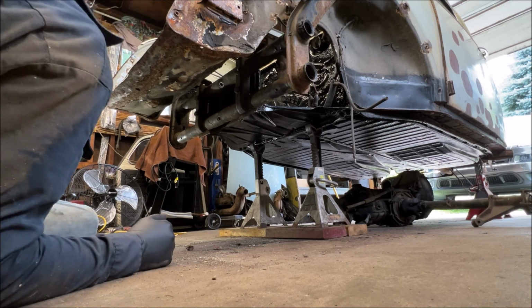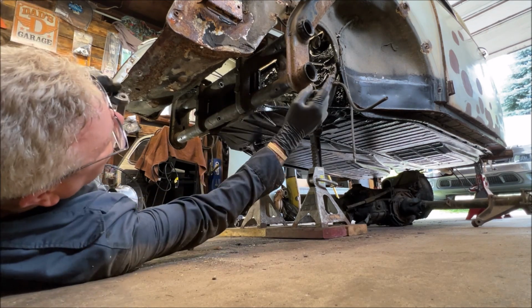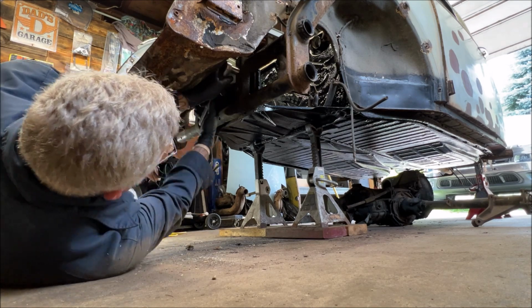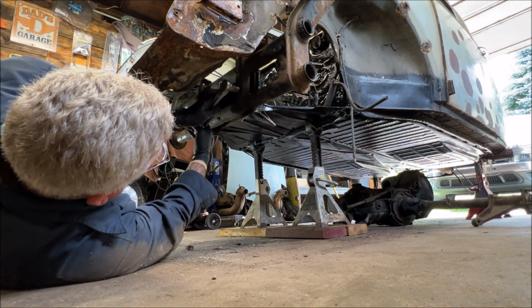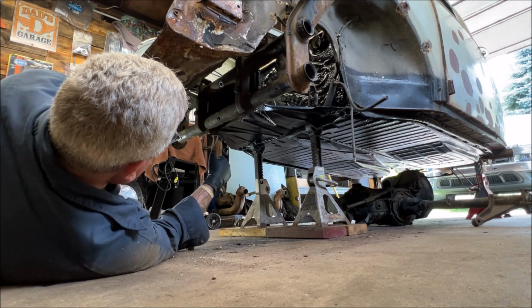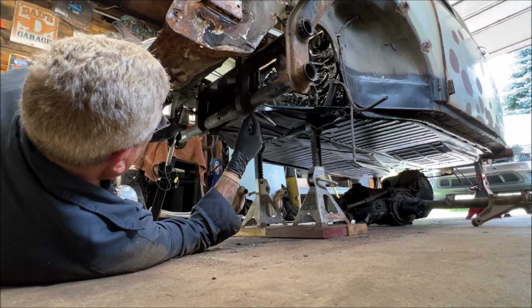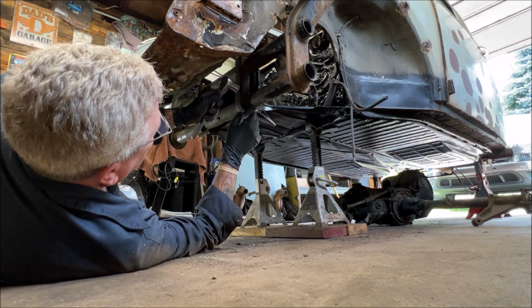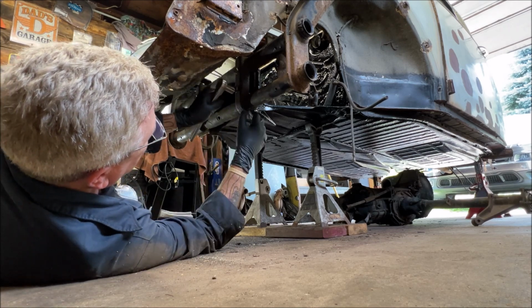Okay, let's go over some things and get this beam out of the way. Now normally these beams are going to be really heavy, but as you can see, there's no control arms, no springs, nothing in here. You have 4 19mm bolts in the front, and of course the 2 on the top are already out of mine. You should put a jack under here and lower it, but I'm going to just do it manually. I'm sure it'll fall, no doubt, because that's what happens.